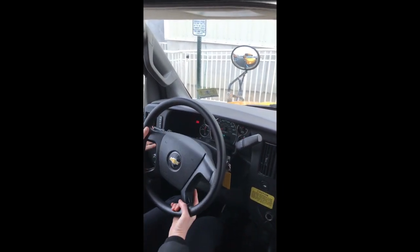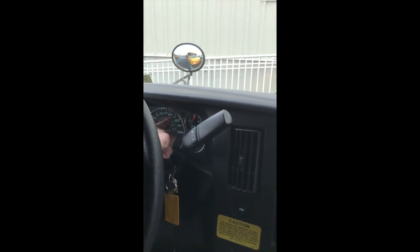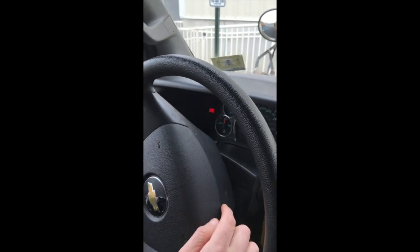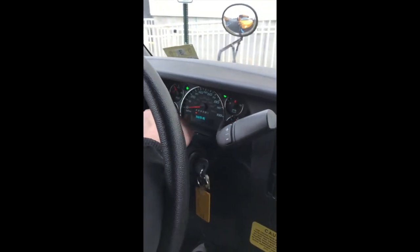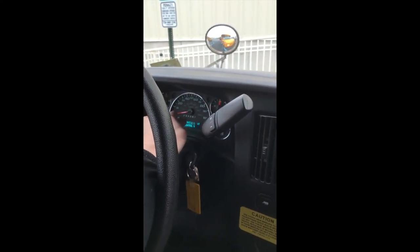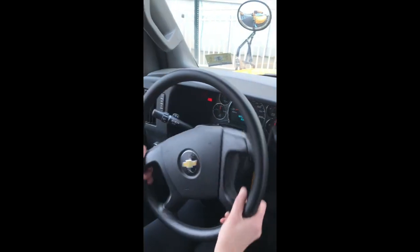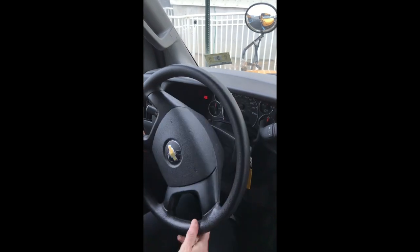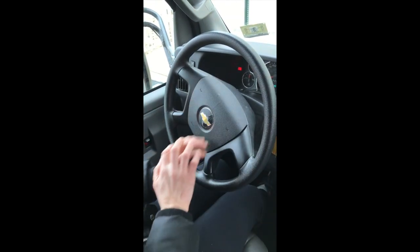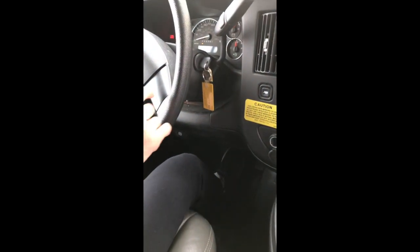We did your dashboard. Check the interior lights — what they're looking for is that the interior bulb is working: right turn signal, left turn signal, high beam signal, and four ways — interior bulbs are working properly. This is your dimmer switch, working properly — low, high. Go to your steering wheel: no more than two inches or 10 degrees on a 20-inch wheel. Your horn works properly.